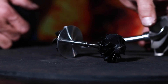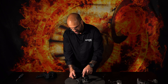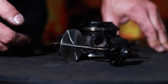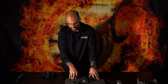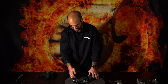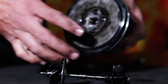Now let's ask the question: how did the turbocharger leak oil? As soon as you suffer any foreign object damage to either the compressor or the turbine wheel, it creates an imbalance in the rotating assembly. That imbalance is the same as tying a brick to your front wheel and driving down the highway at 100km/h — you're going to get an extreme vibration, which will abnormally wear the bearing system. Let's disassemble this and have a look at the bearing system inside.